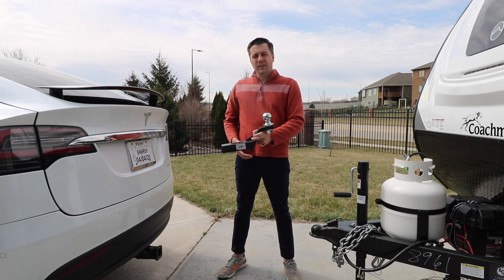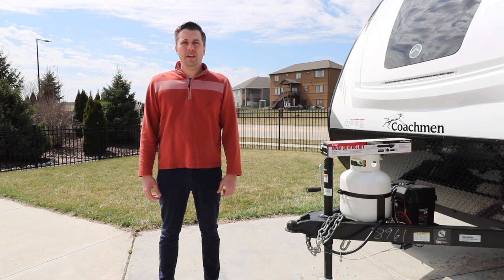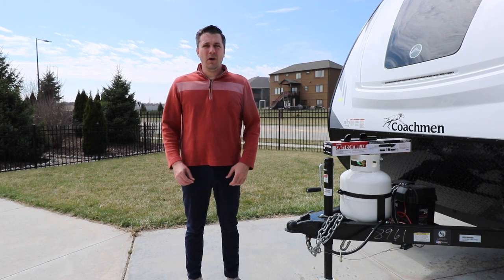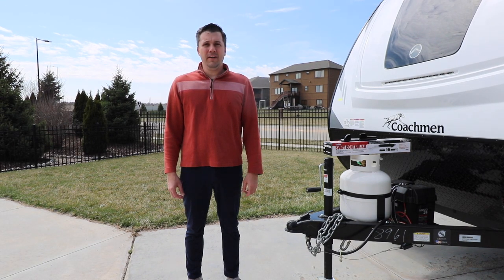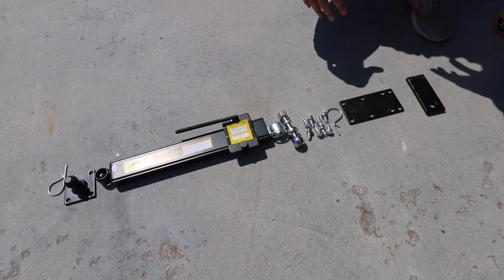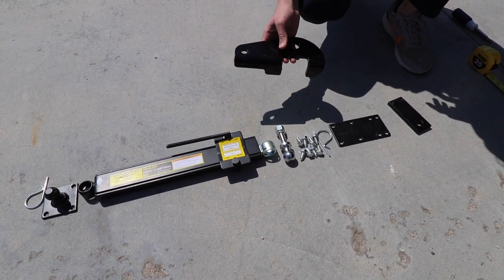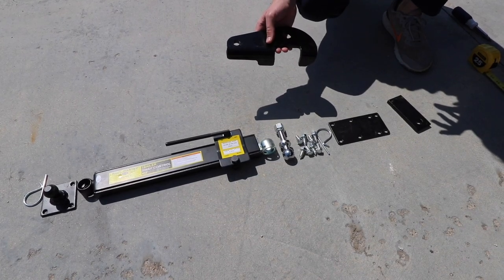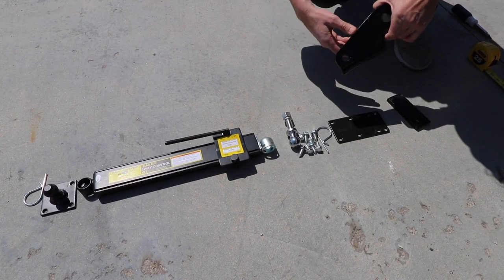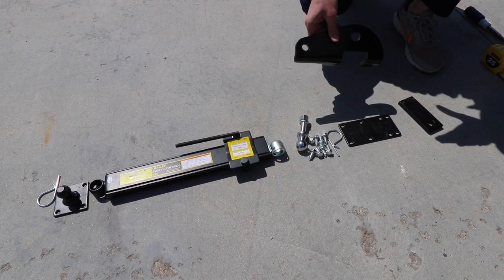That stinger can go right into the hitch, then hook up to the trailer and have it level. We're going to be installing a sway control kit on our trailer. I have all the pieces to the sway control kit laid out. I also purchased an extra piece that goes on the stinger of your tow vehicle, and a ball goes through it so you can attach your sway control. I'll put links to this in the description.